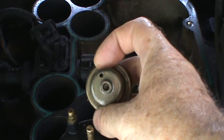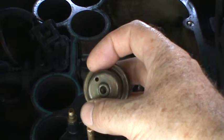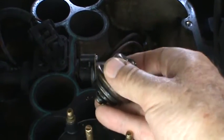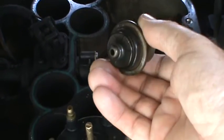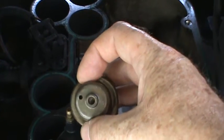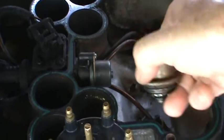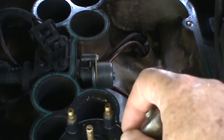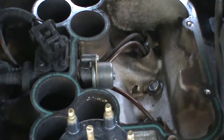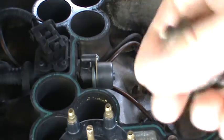It lowers fuel pressure up to about 10 psi at idle speed. This one started dribbling out - I'd key up the ignition, it would prime for about two seconds, and I'd see a little bit of fuel dribbling out. While the engine was running, the diaphragm inside that regulates fuel pressure probably got a crack or little hole in it. Once it starts to leak, it's only supposed to be air acting in that hole creating a pressure differential. That leak created fuel like a mini pressure washer - that's why it's all clean in there. I installed a new adjustable fuel pressure regulator and set it to 62 psi, which is within the spec of 60 psi plus or minus 2 psi.